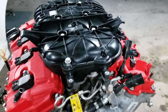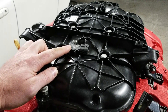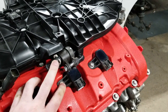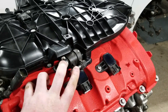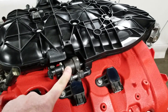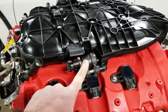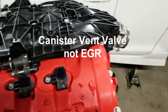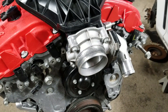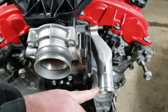The other things you'll need to swap over are your MAP sensor — it's the same one from the other manifold, just swaps right over — and then some kind of valve, probably related to emissions or exhaust gas recirculation. There is an open hole on the manifold so you do want to swap that over. Then there's the throttle body, which swaps right over. I've mounted it here — I think this is the correct orientation — and then your water outlet is right here.